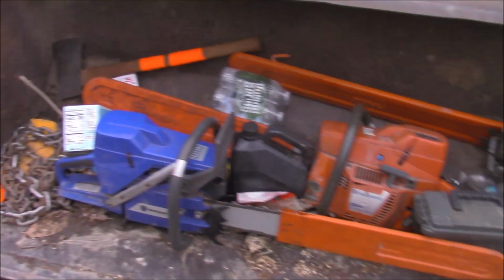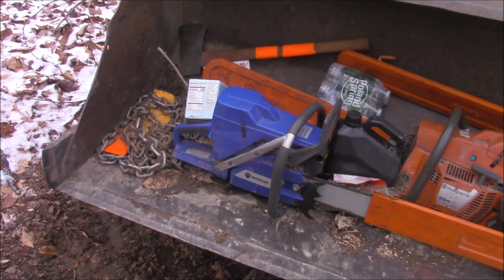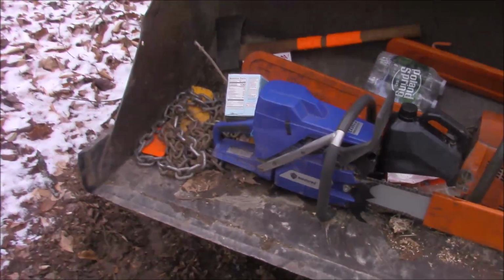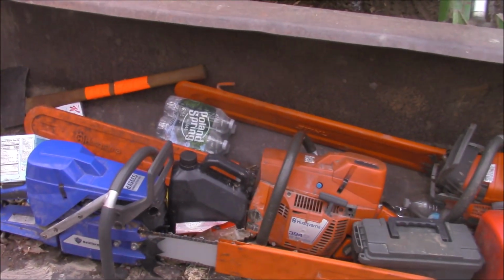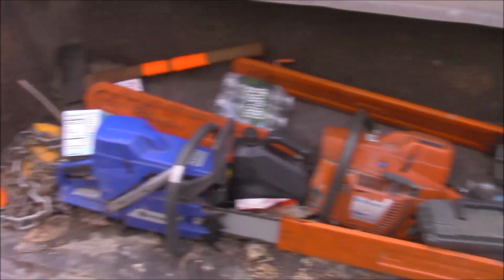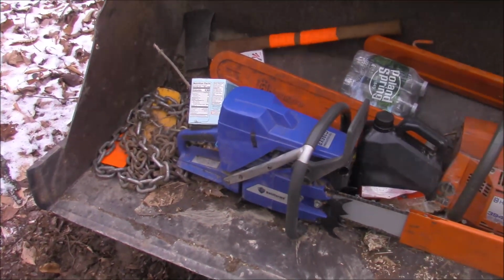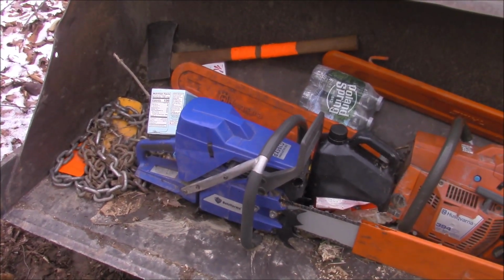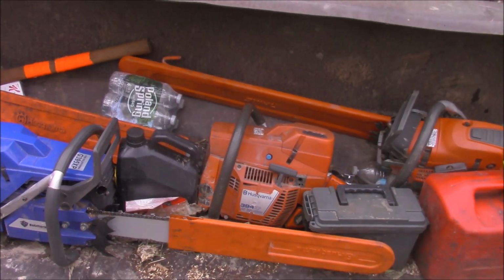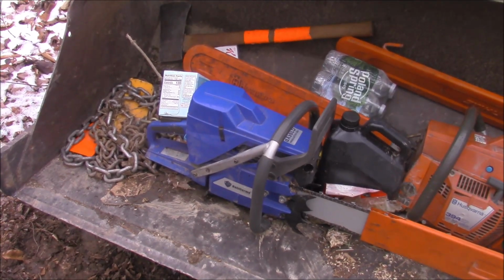This series I started was about, do you start with the Chinese aftermarket clone saw, or do you start with an OEM? Both of those are 394, 395 pattern saws. They're similar. The 394 had the older style top end, 2 big giant transfers instead of a quad port like the 395. And I have to tell you, the G395 has pretty much beat my expectation levels. The reason I put it on here is sometimes I just can't get that one started. I just don't have it in me, but I can get this one started pretty much every time. It's a struggle. I mean, it's a big saw, but I can do it.